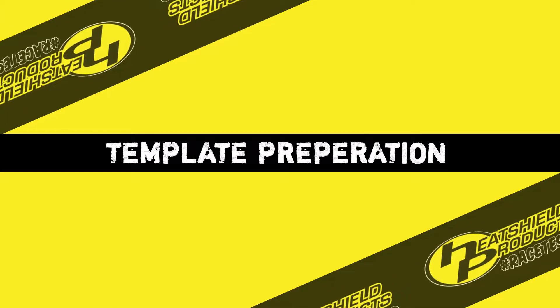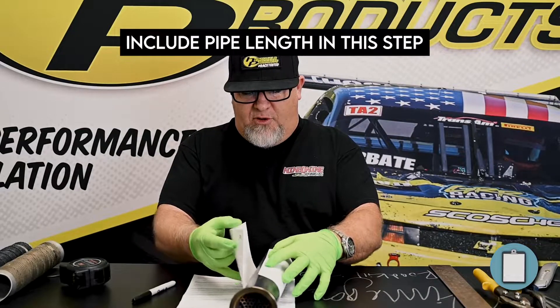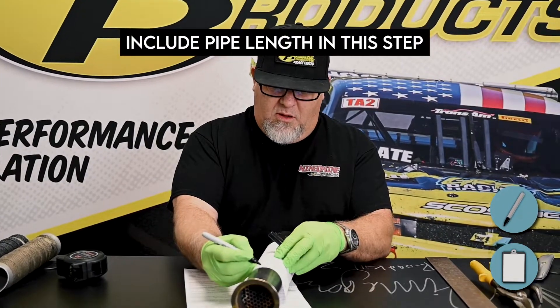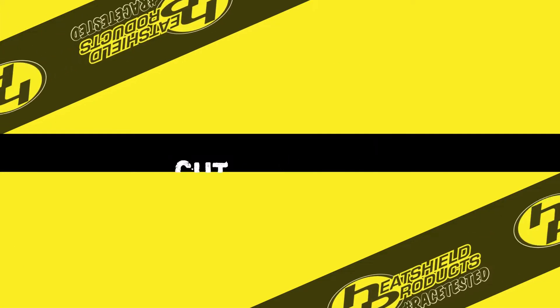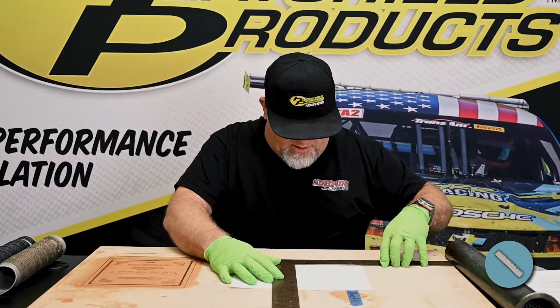For the next step, I'm going to take our butcher paper, I'm going to lay it on the pipe, because I want to get a good idea of what the diameter is around it. I'm going to mark it with a pen — one mark here, one mark here. So now you've got your template marked; now you want to use a straight edge to make that line nice and straight when you put it on your template.